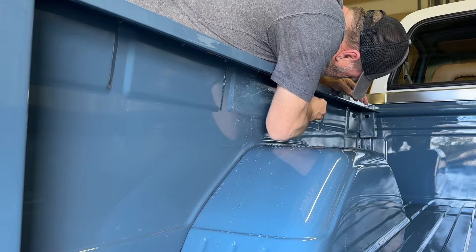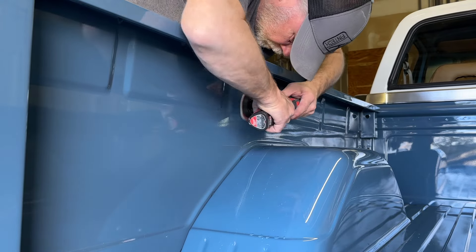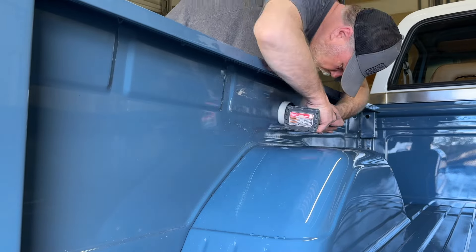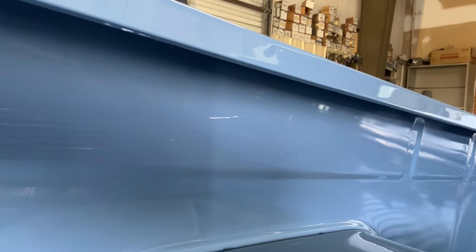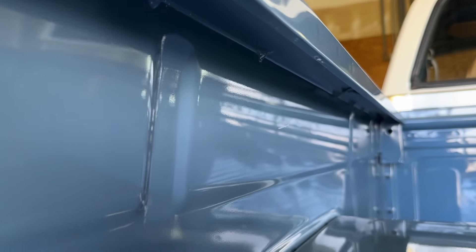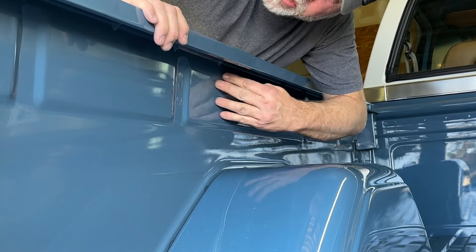Next step is 2000, then I'll go over it with 3000 — wet. It's starting to shine up a little bit. So there's where I went through. Nothing I can do about that. It's flat and shiny now, but it's still got a little bit of the wave to it from the run. Overall it looks better than it did, other than where I went through. It's hard not to do that if there's a run in the sealer — it's just a high ridge, so if you sand it flat, you're going to run into that ridge eventually. I can take some blue paint and drag it to try to hide that bright looking spot, but to make it go away completely, you have to pick a section, roll the edge, make a soft edge, tape it up all the way around, and paint that section or do the entire bedside. I'm not ready to do that yet — this is looking so good, I think I'll do the whole bed.